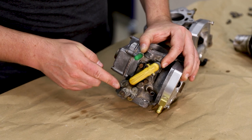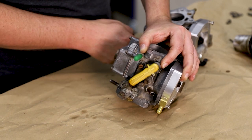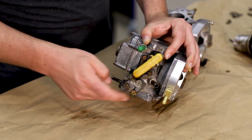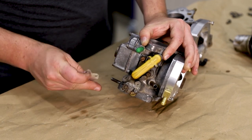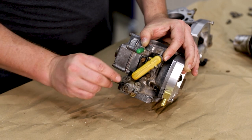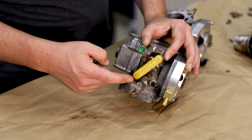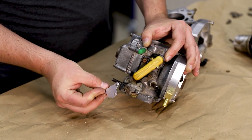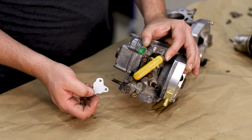Before we can drop the carburetors back in the car as throttle bodies, we need to block off these bypass plates. The one on the other carburetor is in the middle of the linkage which is more difficult to get to, but on this one you can see basically six screws on the face of it. We need to install this tiny piece of metal to block it off. You only need to remove the flat head screws — if you remove the Phillips head screws the unit itself will pop apart, which makes things way more complicated. They say you don't need a sealant, but I'll be putting some gasket sealant on here to seal up any imperfections so I don't have any vacuum leaks down the road.